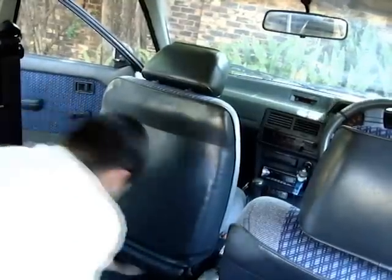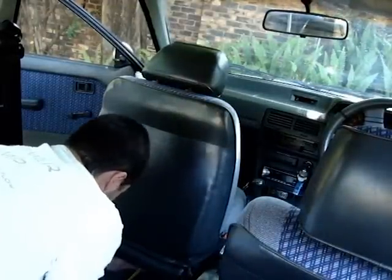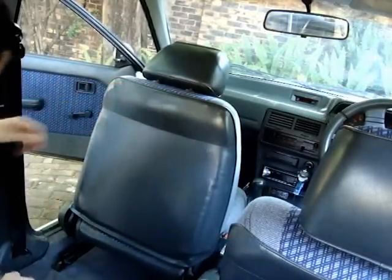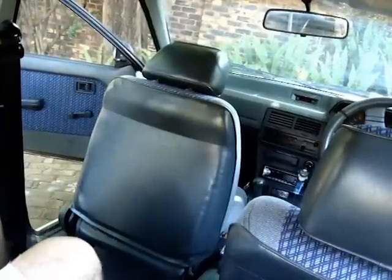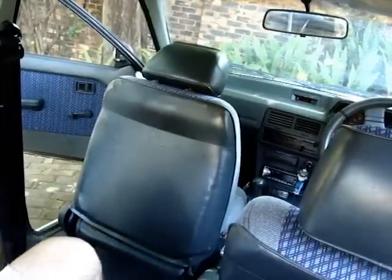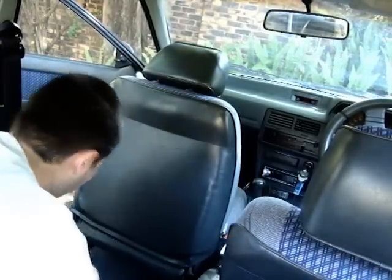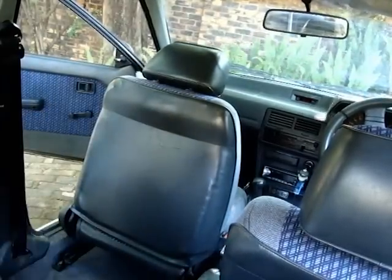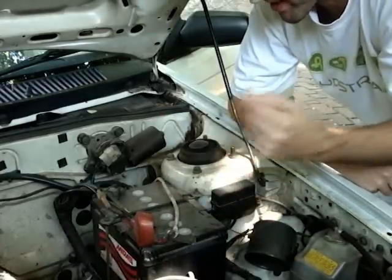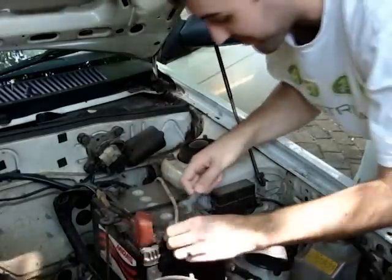This way it's going to sit about there, which means the average person sitting in this car should be quite comfortable — they can't put their feet under but they should be alright. I want to put a block there so they can't actually step on the amp. The first step is to remove the wire going to the amp from the battery so it doesn't short on anything while I'm doing the rest.